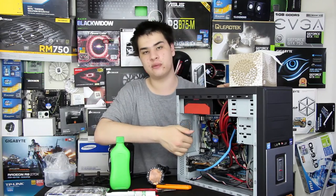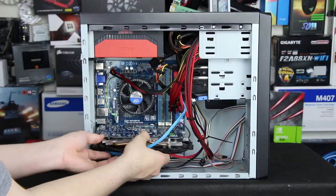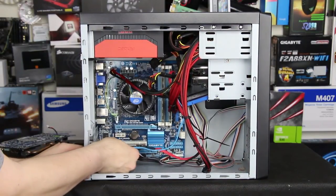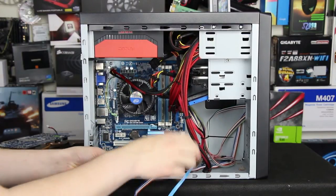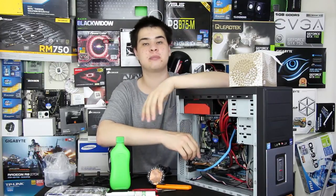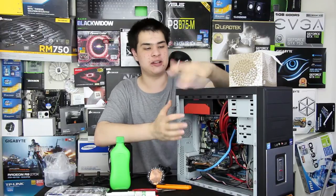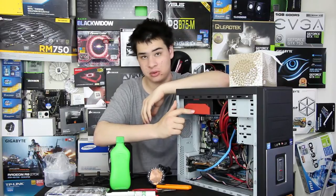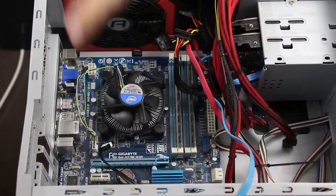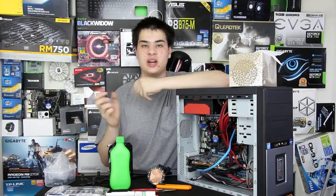To install this cooler we need to remove the motherboard. If you have a RAID card, sound card, or graphics card, remove those first — pop out the screws, pull the cards, make sure no wires are attached, and set them aside carefully. Then disconnect every connector on the motherboard, and take photos first, especially of front IO, so you know where everything goes back. Once disconnected, remove the motherboard screws from the standoffs and lift the motherboard out by the CPU cooler, making sure nothing snags on the standoffs.